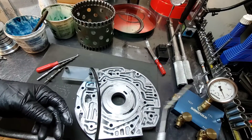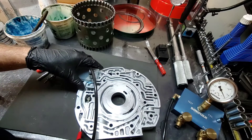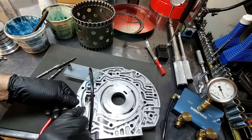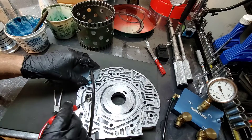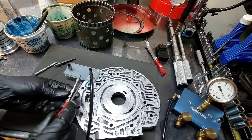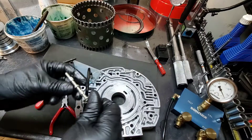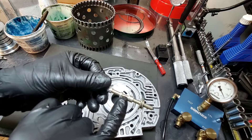Now let's try the severely worn valve. Notice the gauge — this valve is all the way in and it's not even registering. I can actually toggle and wiggle these valves back and forth — that's how extremely worn it is. There's another circuit here, and this one is worn from the front and the back. You can see it's completely gone on the front, the middle, and there's a big groove on the side.